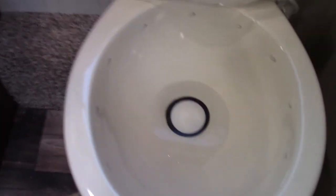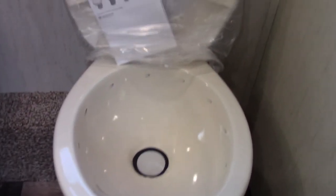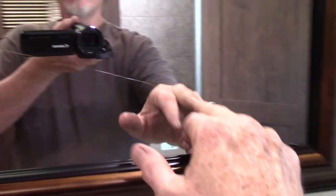Bedroom, of course, with hookups for your TV. Your master bath up here is really, really nice — shower works like any other shower, sinks work like any other sinks. I explained the toilet to you — same principle. The black tank is directly below down there. When it's empty and you're first starting out on your trip, put the chemical in there and a gallon or two of water — you have to have some water in there with chemical when you start using it. This is obviously cracked; I don't know what's been said or done about that, but we will make sure we have to replace that.